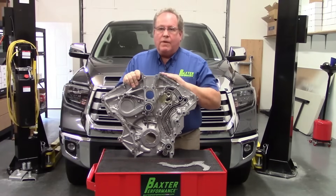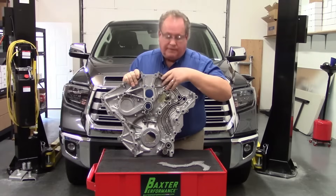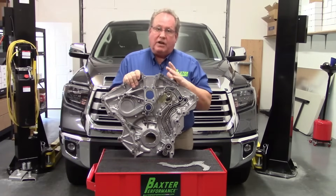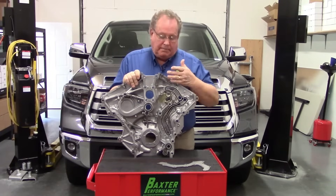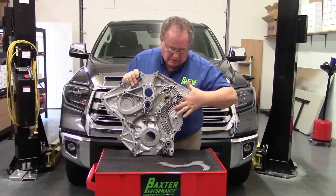There would be a down tube here to feed the main oil galley just above the crank. This oil system is equipped with no anti-drain back valve or any kind of check valve to maintain oil in the filter and the cooler. So every time you shut off your engine, after about 18 minutes this is totally drained out of the front, strained back through the cooler, and all the way back down to the pump.